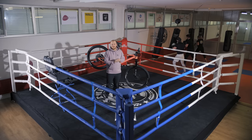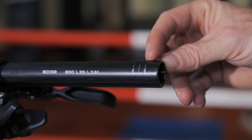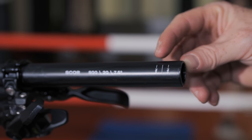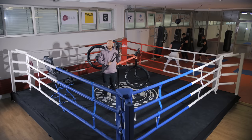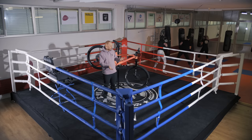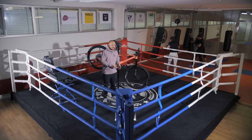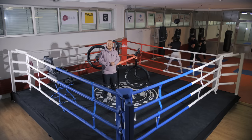How do you reduce the width of the bar? You can simply cut it. For example, on the Score bar, there are direct cutting marks for 780 and 760 millimeters. All stock bars come at 800 millimeters width. A little piece of advice: cut it once — 5 millimeters for example — do some test rides. If it works, great. If not, just cut a little bit more until it's right for you.